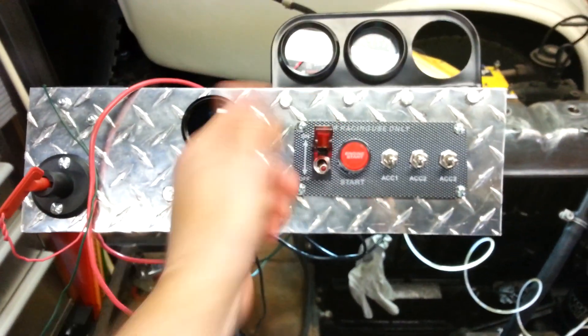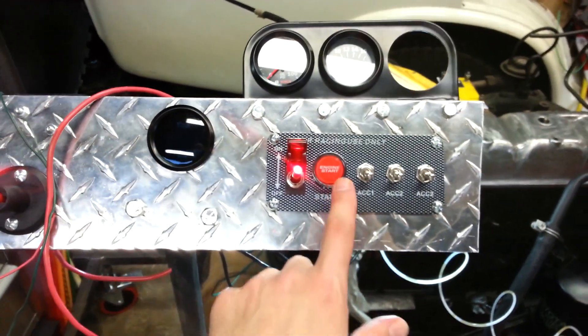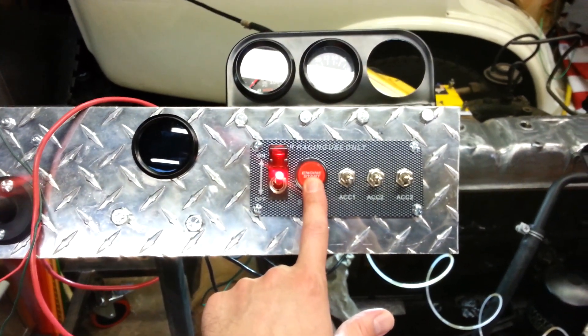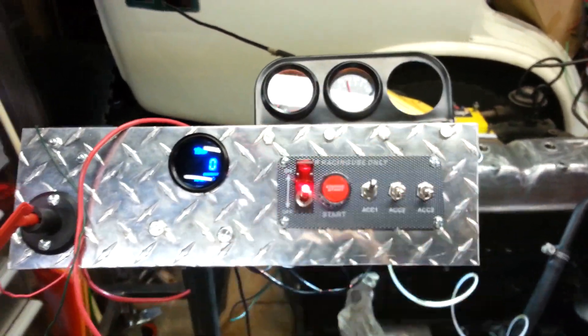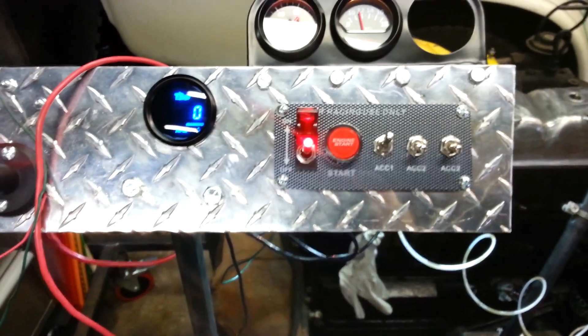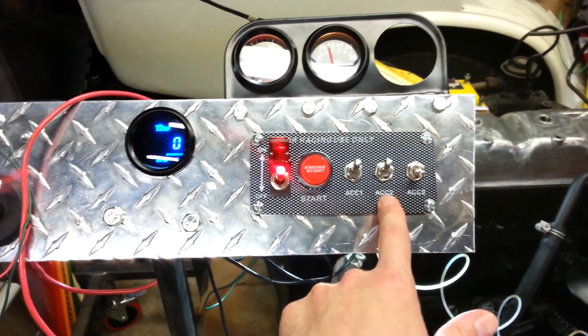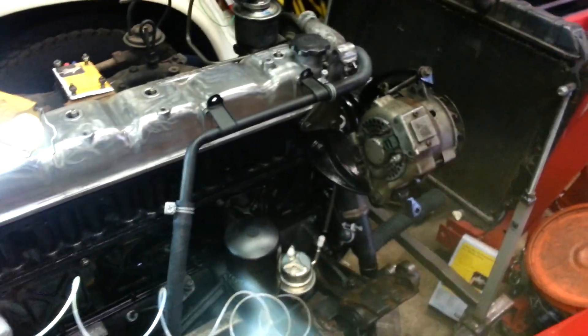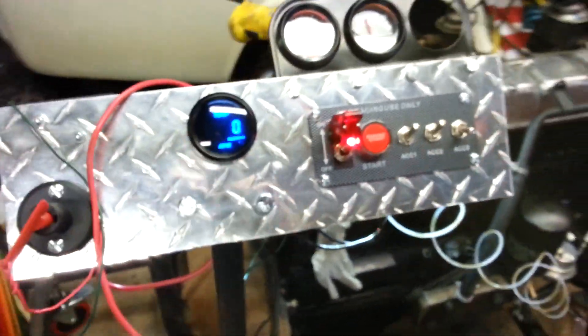Here we go — in my wiring, all that this does: powered on, we get the LED. This engages my start button. I have a fuse block back there I'm going to show you in a second. This is for my gauges — tach, alive. Turns on the lights for the gauges and you can see I've got 11 volts. This in my application engages the positive side of my coil so that my ignition is active. And I'm going to use this one to excite the alternator so that I can run this test stand either simply off my 12-volt jump box or battery, or I can have the alternator help out with that endeavor.